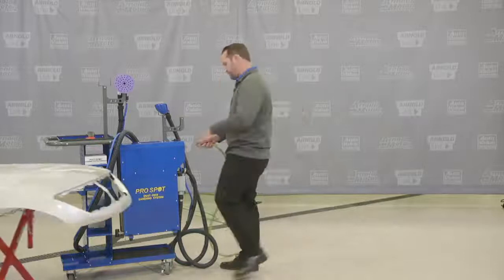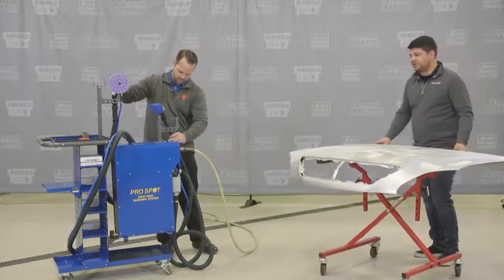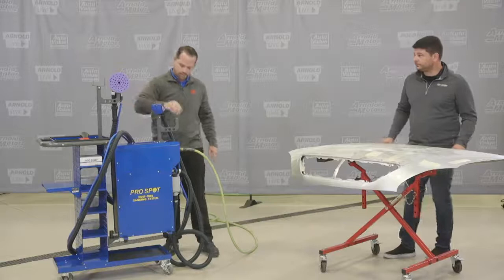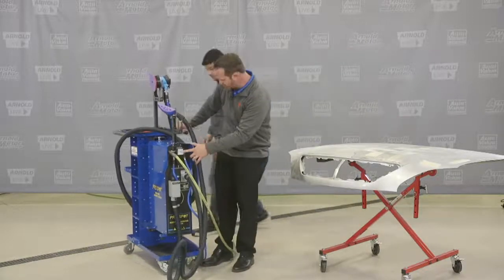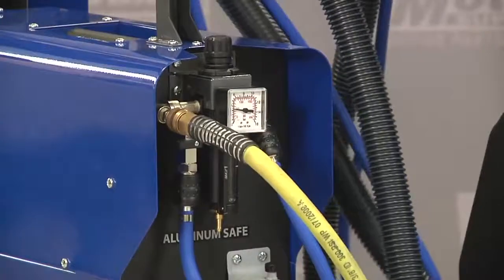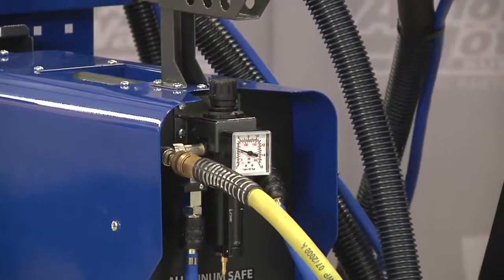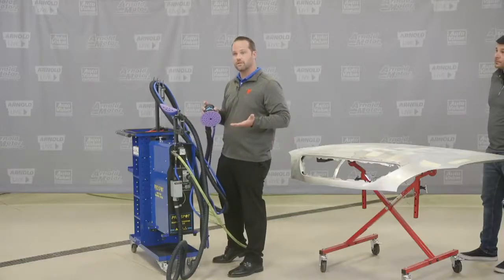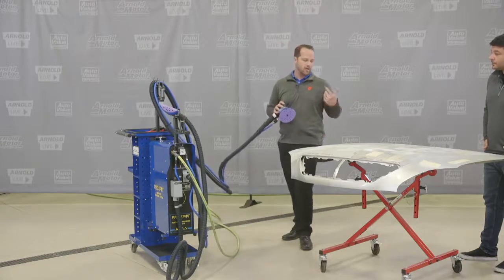Let's do a quick demo — I'm just going to hook up an air hose. We have a hood here that has some filler on it, which is a good example of how well this picks up dust. I hooked up the air — that noise right there is only about two and a half bar. As a technician I can tell I need a little more power. Now I have the DA up to four bar, and now we're talking. Four bar is not bogging down your air compressor and you're getting the performance you're looking for.